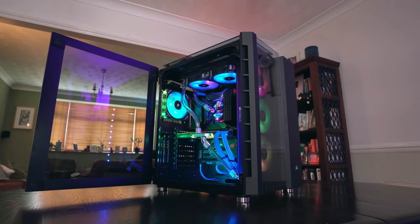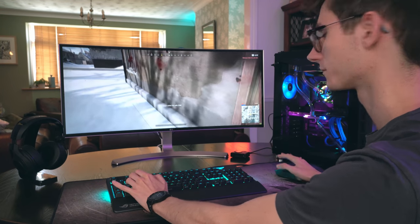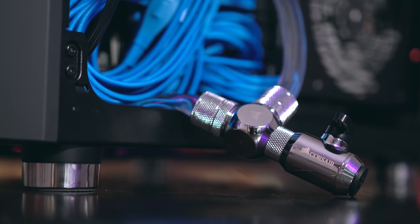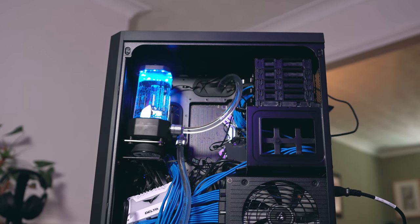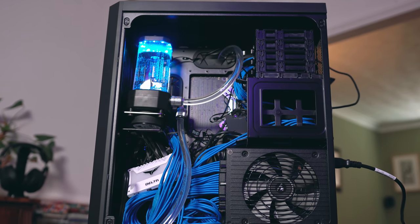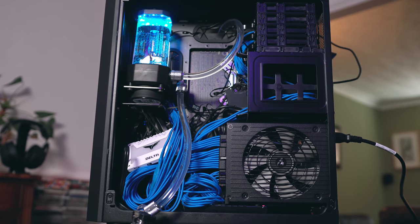You will also need to do a lot of planning, and like anything, you can expect some mistakes. I'll hold my hands up and say that I've created a really ugly draining system and this is going to need to be rebuilt soon, as there's just too much piping on the back. I'll need to shorten the tubes and see if I can connect a draining system that doesn't put strain on the loop.